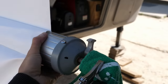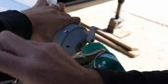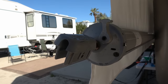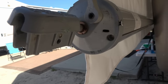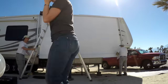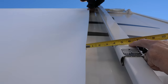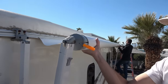We then prepared to rewind the spring by placing a rag over the shaft and connecting the vise grips again. Remembering the number of turns we had taken out, we went in the opposite direction and slowly added the turns back into the spring. We made sure the latch was in the lock position to prevent it from unwinding. If you need more spring tension, now is the time to add a few extra turns on both sides. Once the appropriate turns were back in, both end caps were checked to confirm they faced the same direction — since the bolt only goes in one side, they must be aligned. We then rolled the fabric back onto the tube while walking up the ladder, centering the fabric between the awning arms and on the roller, before bolting the caps back into the awning arms.